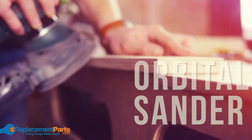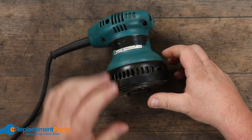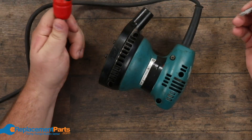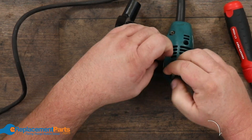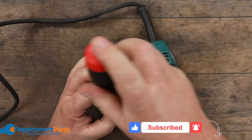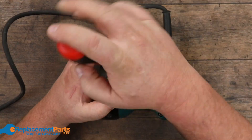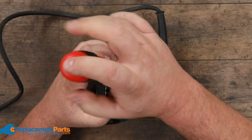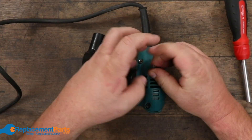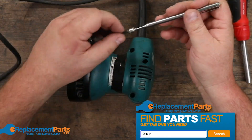Pretty well everyone has one of these at home. The base plate we took off just has the velcro — there's nothing there to see. We're going to open it up and have a quick look inside and talk about some of the parts inside. Orbital sanders are pretty well almost all the same. There's not much difference inside. There's difference in quality of course, difference in bearings and bushings and electric motors, but other than that they're pretty well all the same. So don't be afraid to open them up, especially if you find one on the side of the road or if your own is broken — it's going to go in the garbage anyways. You might as well open it up, see if you can figure out what's wrong with it, and then order the parts and get it back online.